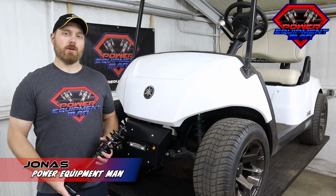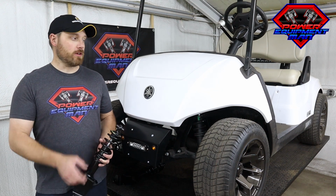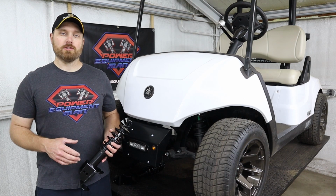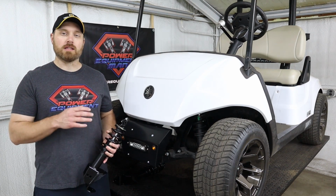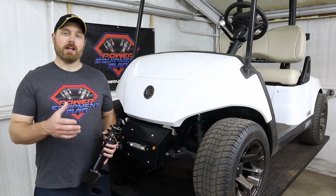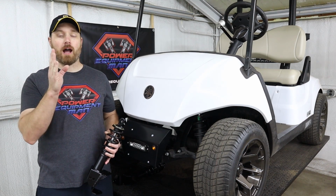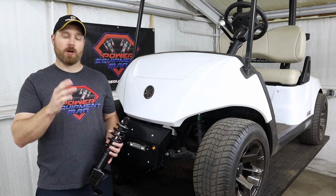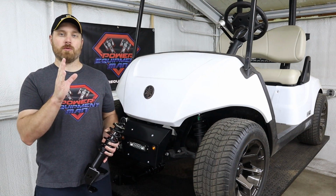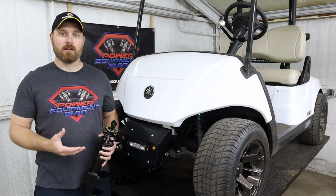Hey guys, I'm Jonas. Today we're going to be going over how to install these new camber adjustable front shocks for your Yamaha Drive1 or Drive2. Now these new adjustable front shocks are designed to help correct alignment issues on the Drive1 or Drive2s that have a camber problem. So the top of the tire being too far in or out, either a positive or negative camber. These are adjustable to help you bring that camber back into where it needs to be, especially after installing a spindle style lift kit.